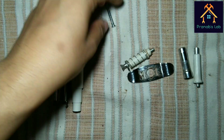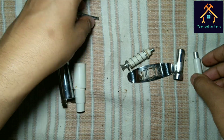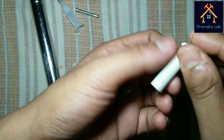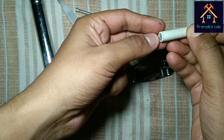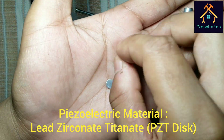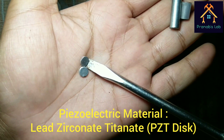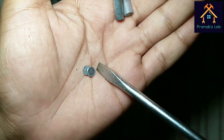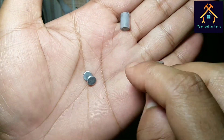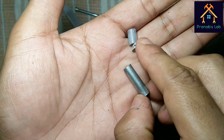This is the working electrode and the plastic works as the insulator between the electrode and the steel pipe. This is the ignition head anvil which receives the hammer stroke. And these two are the small circular segments of piezoelectric material — it is the heart of the gas lighter. These two materials are kept between the two anvils, and the anvil strikes the piezo like this.